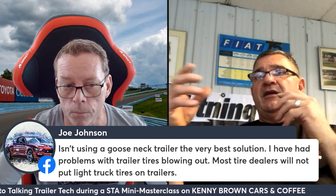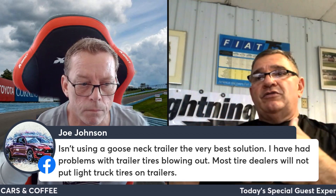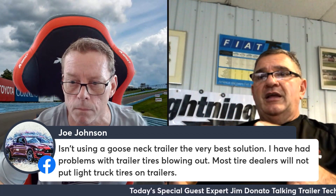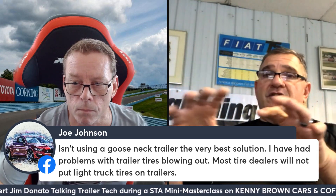Yes — the separate friction control devices have a friction material that over time will wear out and will have to be replaced. You always want to use some good anti-seize in different places, and lithium grease on the ball and on those devices. The sway control devices themselves have a material like a brake shoe or asbestos material that will wear out over time, so you'll have to keep tightening and tightening it up. Then there'll be a point — just like brake shoes or brake pads — where they will be worn and you'll have to replace the device itself. On the subject of trailer tire blowouts, make sure to match your tire to the weight. Also, if the axles of the trailer have never been rechecked, hitting bumps and bouncing off curbs can jar the axles off a little, causing uneven wear inside and outside — just like toe-in and toe-out on your car — which can cause the tires to overheat.